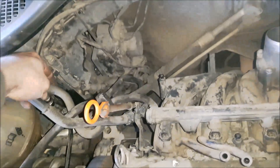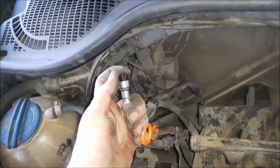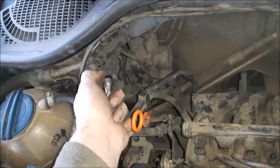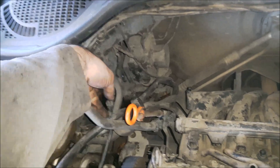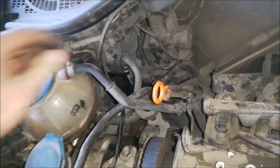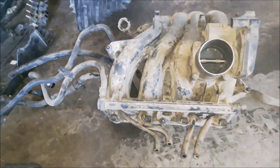I have also disconnected the hoses from the petrol line. For quick removal, just press down like this and then up and you can remove it. This one is from the EVAP valve — there is one pin here, just press it and pull it up. Now the inlet manifold is completely removed.